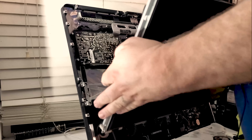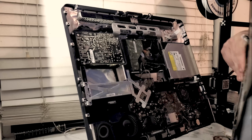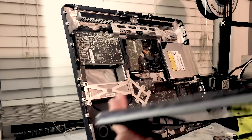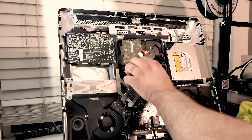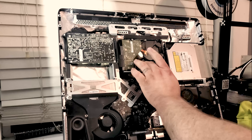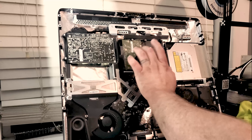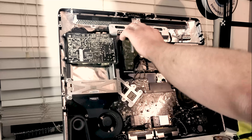There will be some things that you have to unplug — you've got to be so careful. Every single ribbon cable you have to unplug, and there's your display. Really not that bad. Now it's not really that dusty in here. I'm taking this hard drive out anyway. There is a fan sensor hooked to this hard drive — when we take it out we're probably going to mess it up. Nine times out of ten that fan sensor doesn't work right again or it just sticks to the hard drive. There's an app for that and I'll show you what it is as soon as we get it put back together.